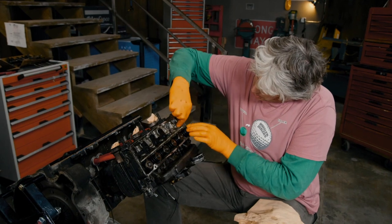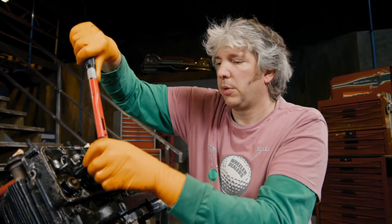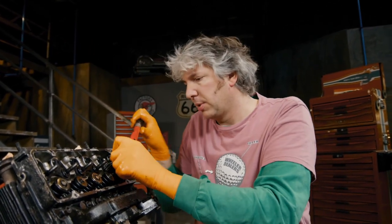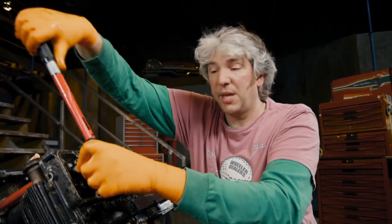Just pop the last of these little O-rings in, just go underneath the retainers. It's kind of interesting that these guide plates — or the bolts that hold them in — are doing two jobs: they're not only holding the guide plates in position, but they are also holding the head down. That's why it's really important to get the torque setting correct. If it's too little, you're going to get exhaust gases blowing out between the barrels and the head. If it's too tight, you could actually shear them off. Because this is air-cooled, things actually get loose often, due to all the heating up and expanding, and then shrinking again when they cool down. Every time you use the car and park it up, it's worth checking the torques on the head bolts — probably twice a year wouldn't hurt.